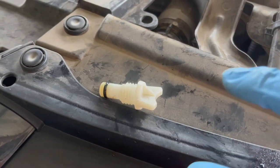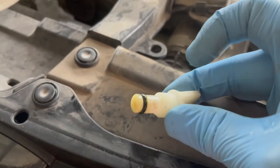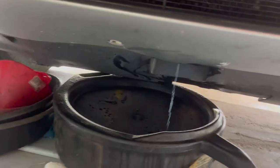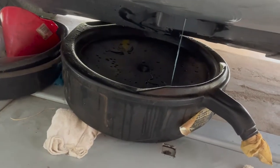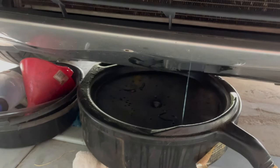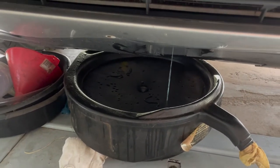In case you're wondering what the petcock looks like, I went ahead and pulled the entire thing out. I'll wipe it and replace it. Word of advice: we had two catch pans but the coolant still ended up getting on the splash shield and spilling out, so make sure you have a couple of catch pans so it doesn't end up all over your garage.